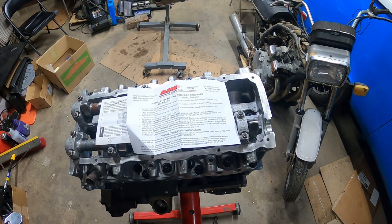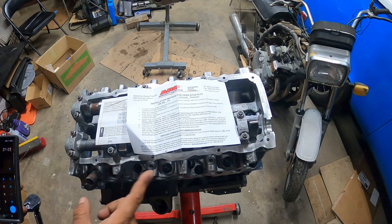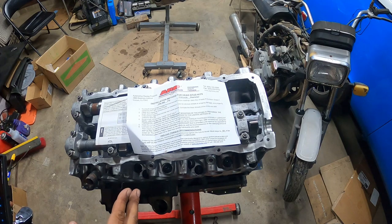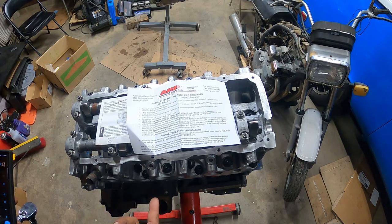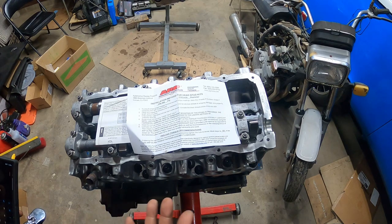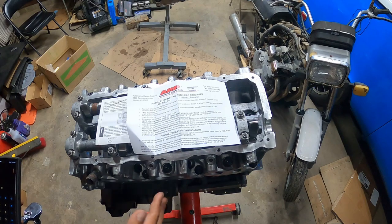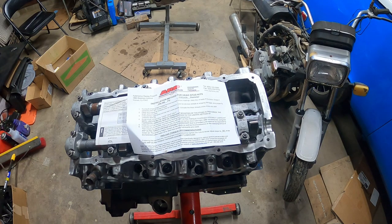Get my calculator. 80 divided by 3. So you can do 27 plus 27. So the first set of weight is 27 foot-pounds. The second set is 54 foot-pounds. And the last set is 80. Not bad. So 27, 54, 80. That's all we got to do.